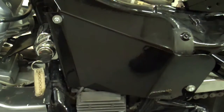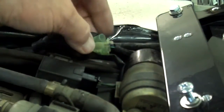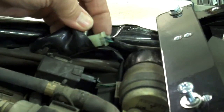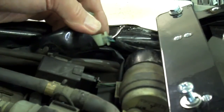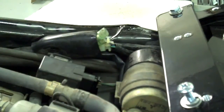One other thing I wanted to mention: I had a hard time starting this motorcycle. There's a connector in here that I disconnected when I did the wiring. Make sure that's plugged back in if you try to start your bike, because that evidently actuates the solenoid and shuts the fuel off to the motor. Be sure that's plugged in if you're going to run your motorcycle. Thanks a lot — bye bye.